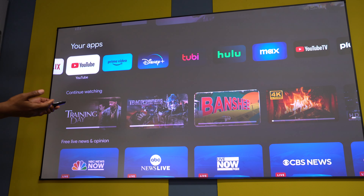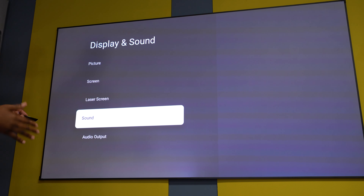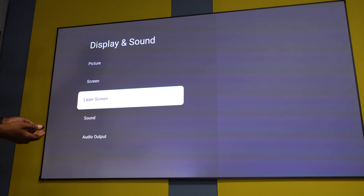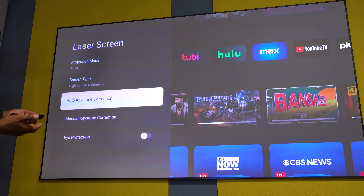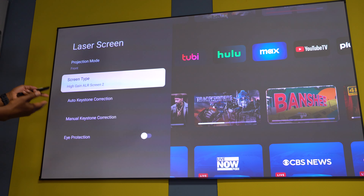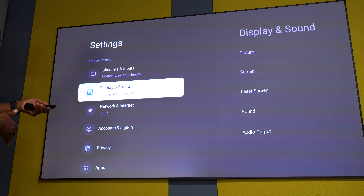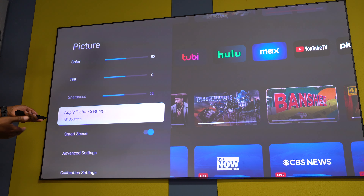It has two little sensors on top of the projector that will actually shut the screen off if you step in front of it. Let me demonstrate — I've got this feature turned off, so I'll go into display and sound, then laser screen, then eye protection and turn it on. Now if I step in front of the screen it sees I'm here, and you get a countdown saying get from over here because it wants to protect your eyes. That way if you have children or pets, they're not blinded by this 3,000 lumens of light projected into their eyes. Let me go ahead and turn this feature back off so it doesn't black out while I'm talking to you.